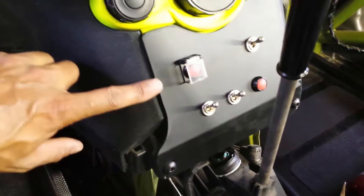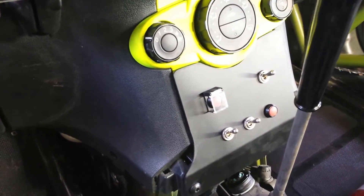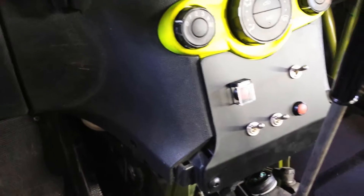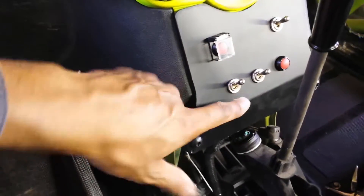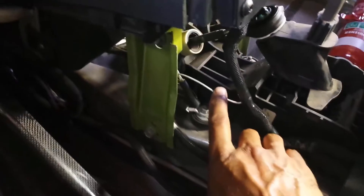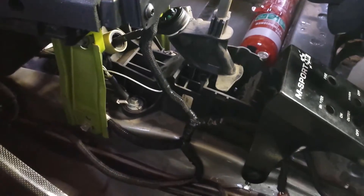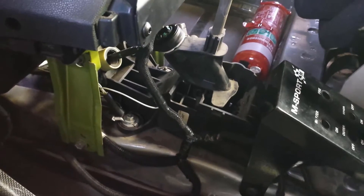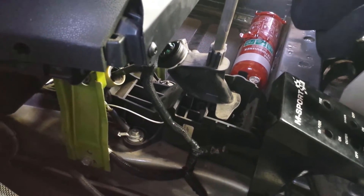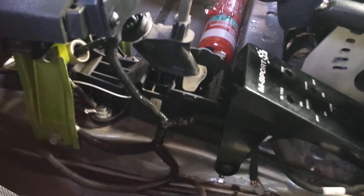It also meant we had to fabricate this little panel here. As you can see, we made it out of 1.5mm aluminium, used it to fill the gap where we'd taken the plastic shrouds out, and neatly drilled all the switches and buttons. We'll label those shortly when the wiring is all put back together — fire extinguisher, spotlight switches, horn, etc. The whole M Sport wiring loom has every single wire in white and it's all very fine wire, so it wasn't particularly easy to rejoin them with no colour code. We had to open some of the loom up and shuffle some wires around, but we managed to get it.